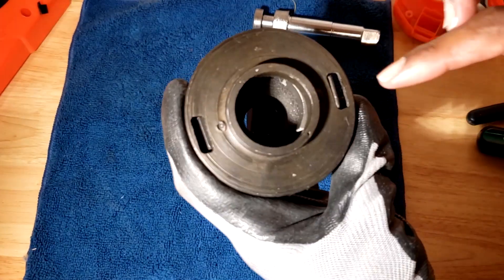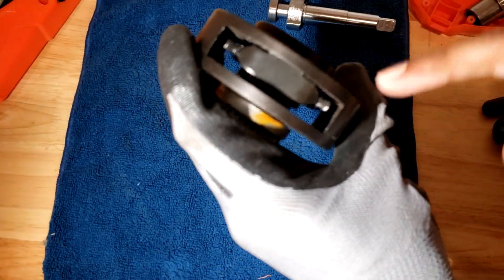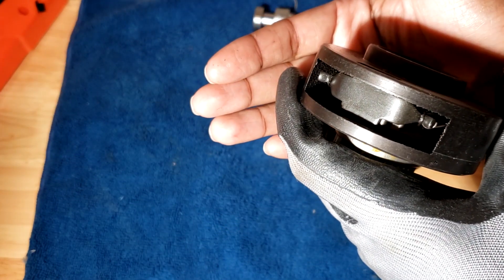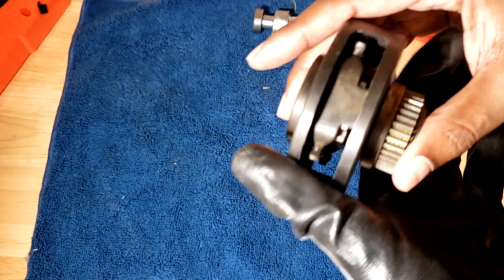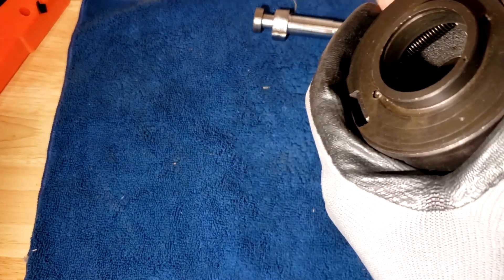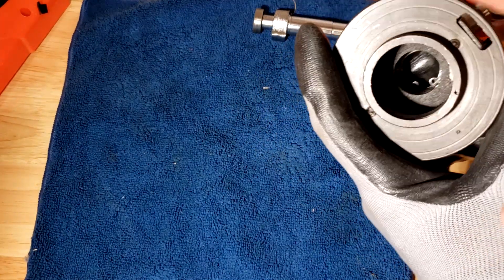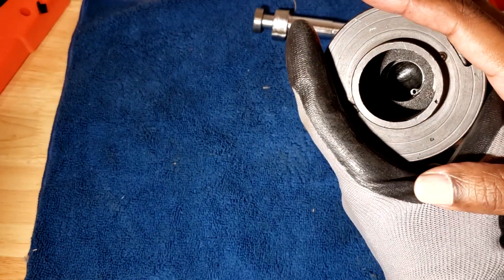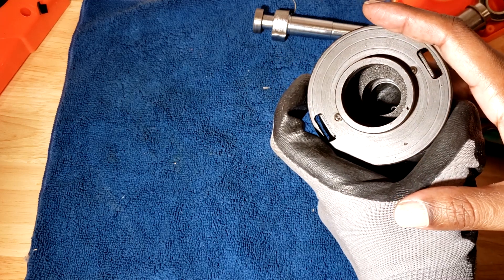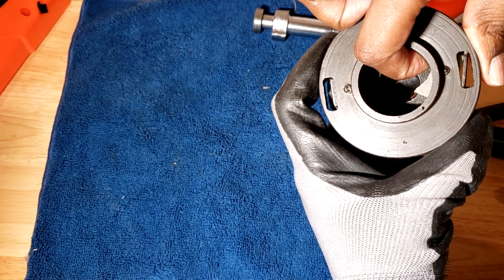This one is hard to describe how it works because it's not two pieces — it's one piece. If you look here, you have a plate on the end, and on the other side, another one, and there are two springs. These springs are actually holding these two teeth in that position until a certain RPM, at which point these two plates spread apart and the teeth will swivel down and just drop down and lock onto the anvil.